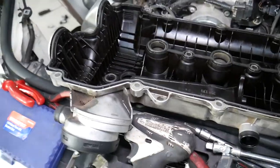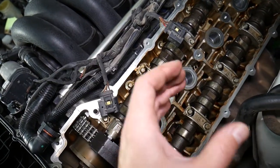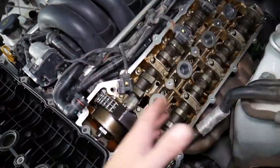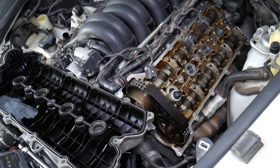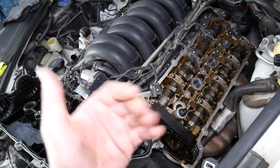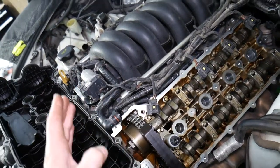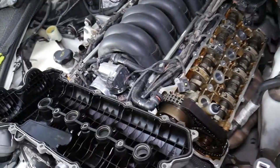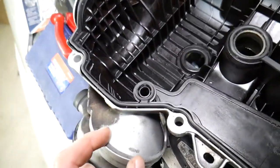Let's explain what it does. When the engine is running at idle, it creates vacuum. But when the engine revs up at high RPMs, the pistons go up and down really fast — that creates pressure. That air needs to come out somehow; otherwise it will damage all the gaskets, valve cover gaskets, crankshaft seals, and everything will start leaking oil — you can even damage your head gasket. But you can't just release that pressure into the atmosphere like in the old days, because everything would be oily and the car wouldn't be efficient, given modern electronics for fuel injectors, lean mixtures, and sensors that detect air going in and out of the engine. What the oil separator valve does is separate the oil vapors from the air — that pressure mixed with oil fumes needs to be split.